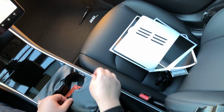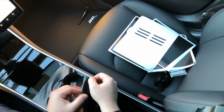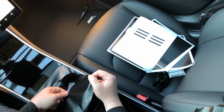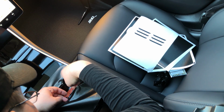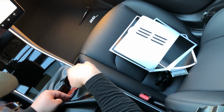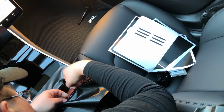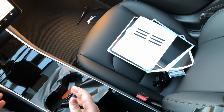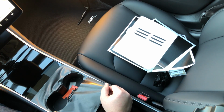You're good there. Now, the next thing that you want to do, very slowly around these areas, because we don't want to tug on it too much. Pull that up. Now we want to align the back center of the cup holder. And so we're going to put that right there. I think it could be a little bit further over. Okay. You just want to eyeball this. It's pretty easy to get it in the spot where it looks like you have about the same amount of material on either side. Now that looks like a big mess, and you might be like, oh my gosh, I must have ruined this. Well, you haven't. Just watch out. This is going to clean up real nicely real fast.